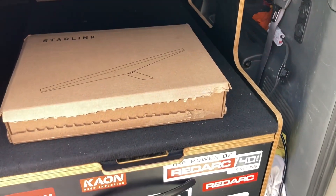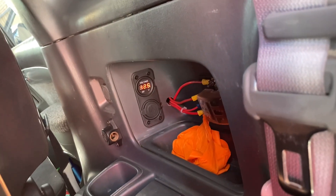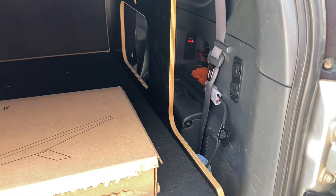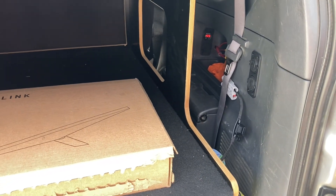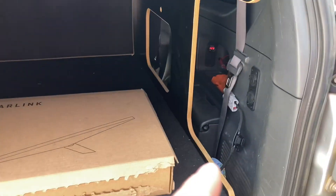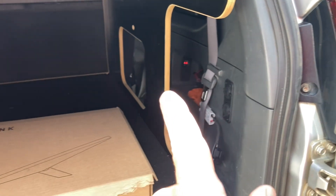What I wanted to tell you is the battery — Century — it was sitting on 12.85 volts. You might be able to see that says 12.5; that's just rounding it. We had a multimeter, we measured the current and all that sort of thing. When the fridge is running, I know it uses about 2.5 or so amps. With everything off, the voltage was 12.85. Remember, a bit of voltage drop because the battery's at the front and the wires run to the back.